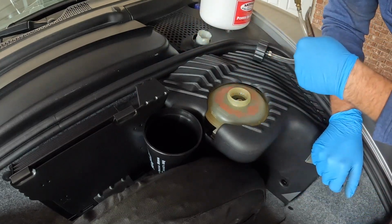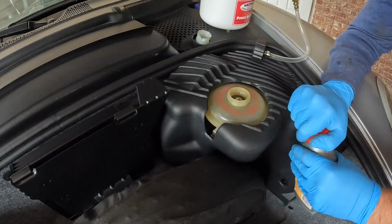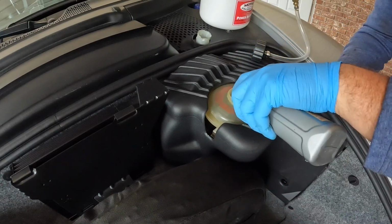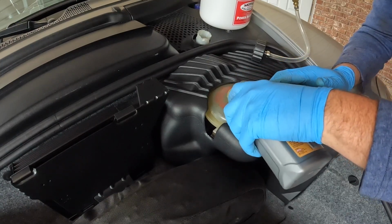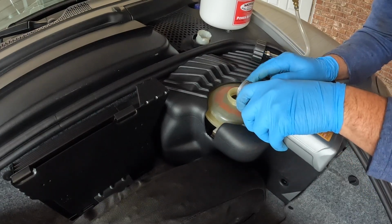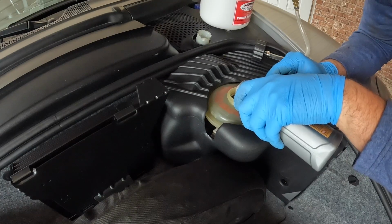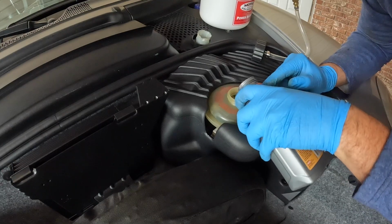Remember, brake fluid, paint, don't let the two touch. Keep them separated. We've gotten out as much as we can possibly get out of there. So we're moving on to adding RBF. Now I'm told that these won't mix. So the new stuff is a kind of clear yellow, looks about the same color as the reservoir itself. And then the stuff that was old is kind of a teal blue, much darker color than this regardless. So I'm gonna fill that right to the max line.